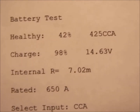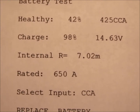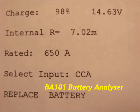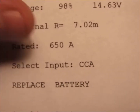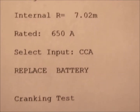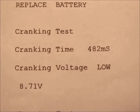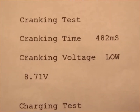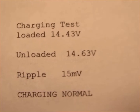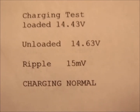Here's the data from the corvette that I got off the BA101 battery analyzer — you can print it out. If you get data you're not satisfied with, you can take it down to your mechanic, share it with him, and show him what you've got. Get a professional to analyze everything and verify what you're suspecting. Here's my charging test off my 1984 Corvette that shows the ripple.